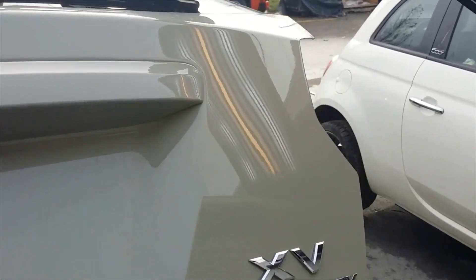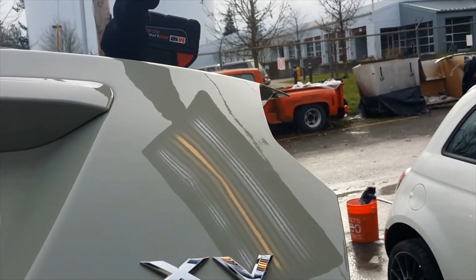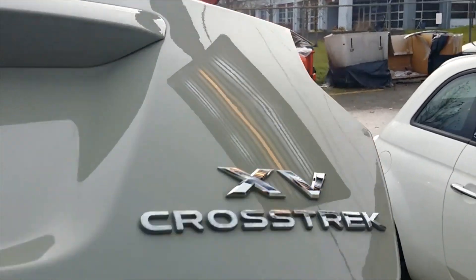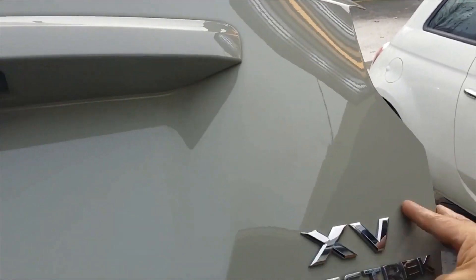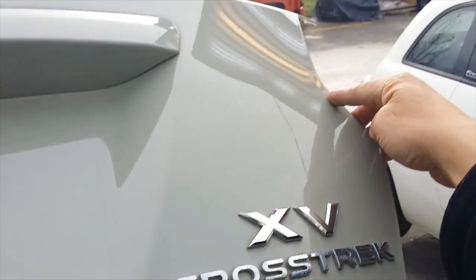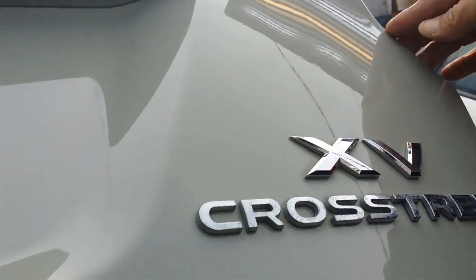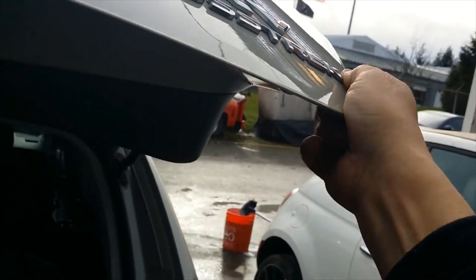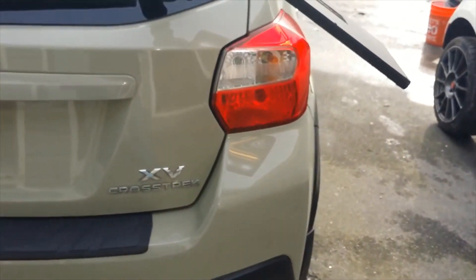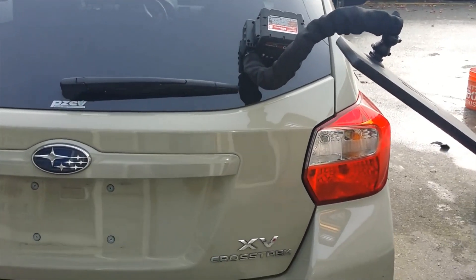And we're back — let's get the end result. Let's give you a couple of different angles. If you look down you'll see there is a slight little wave right about there — kind of like looking for a needle in a haystack to see that. There is this edge up here that just is not going to come out — that's just part of the deal. You can see how that edge tightens up around there. That's just part of the physics of the way they folded over this metal — to get that line out is very, very difficult. The dent came out looking pretty nice. Basically the difference between a dent and no dent. If you guys like what you see, make sure you hit that like button, and if you want to see more, hit that subscribe button. PDR signing out, peace.